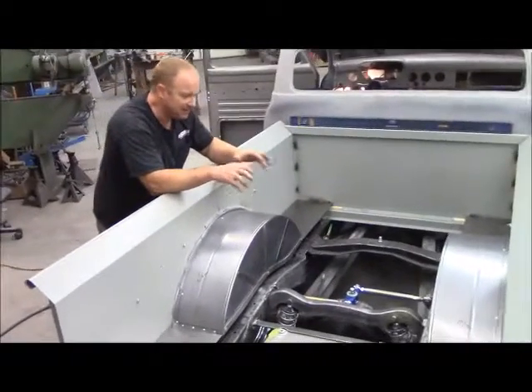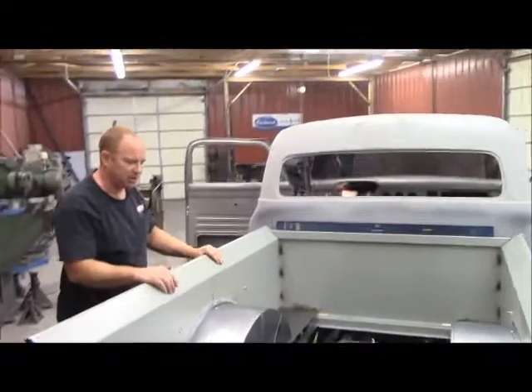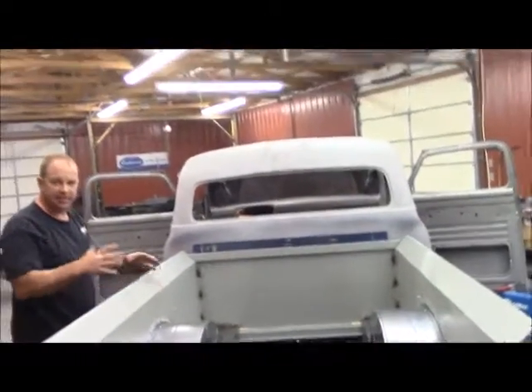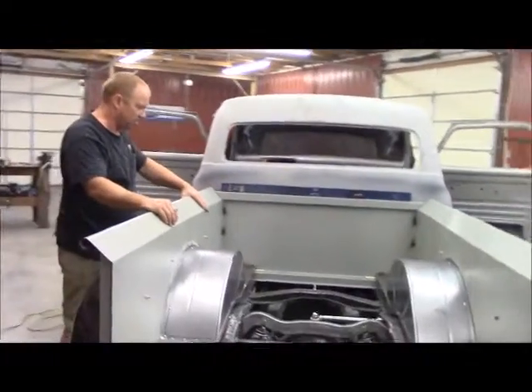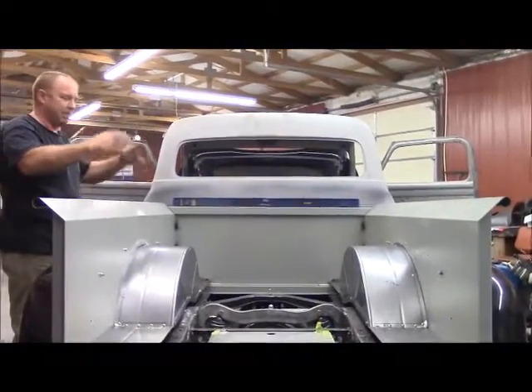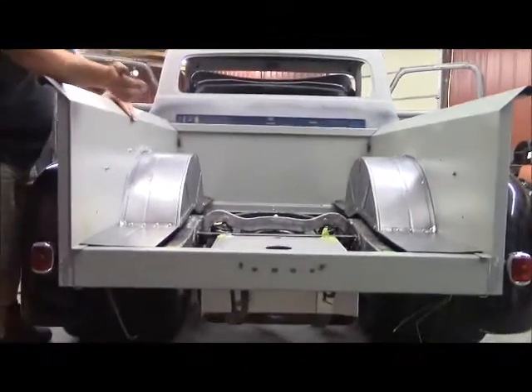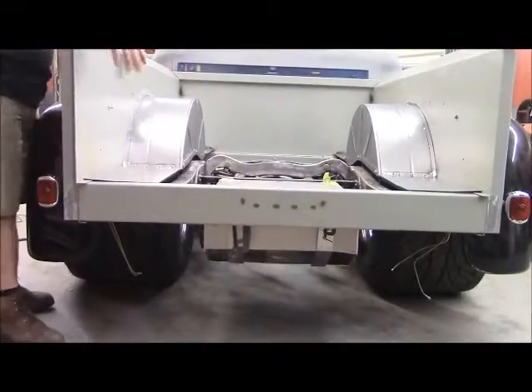I also let a lot of air out of my tires — I've got about 15 pounds of air in them so I've got them squatted out to get the most out of them in case they move around or rub. If I put more air in them they get skinnier, and if you build around it being up and skinny it can create trouble later on.